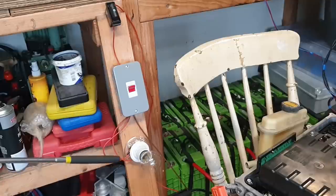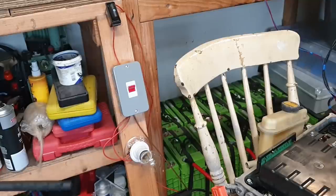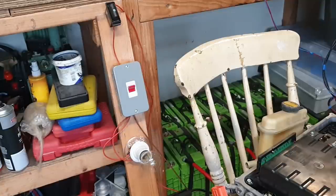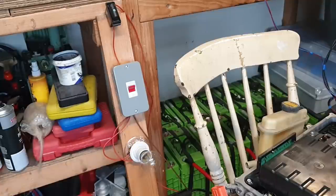The first is to pre-charge our inverter capacitor. I'm not going to explain what that is. If you do not understand that, please stop what you're doing now and go and learn how EV pre-charging works. The lamp is particularly useful here because it will give us a visual indication of that pre-charging process, as we will see in a few minutes. Also, during initial testing, it will illuminate depending on how much current that our system draws here, and it will also serve to limit any fault currents that our inverter converter may try to draw from our high voltage battery.